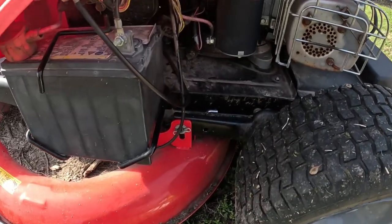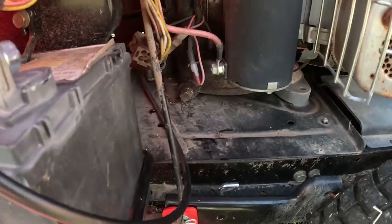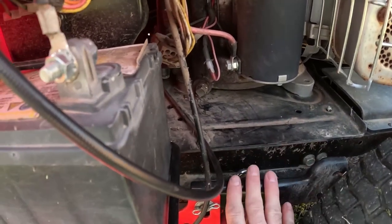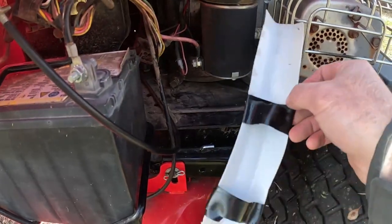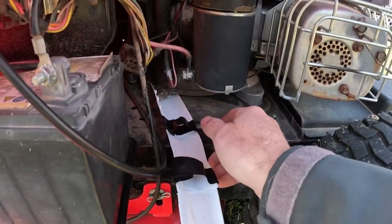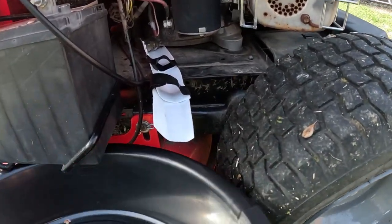If you look right here on the side with the battery and you come in close, right there is the nut that you need to remove to drain your oil. Unfortunately, if you pull that nut out and you don't have anything to catch that oil, that oil is going to drain all over this platform and drip down and get all over the place. So this is what this little contraption is for — it's actually part of a milk carton that I cut out and taped together so I can slip right up underneath here, underneath that nut, and it will channel the oil down and into my drip pan.